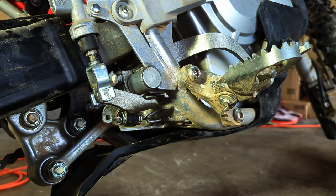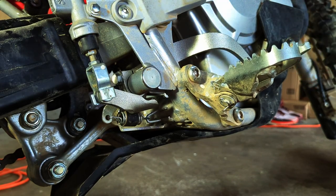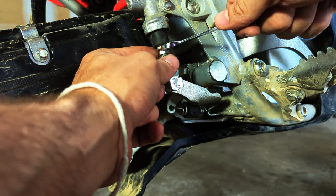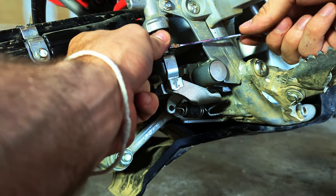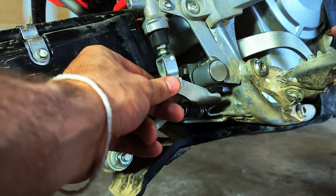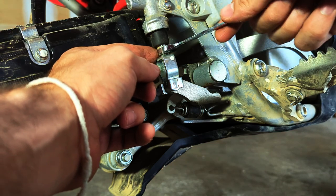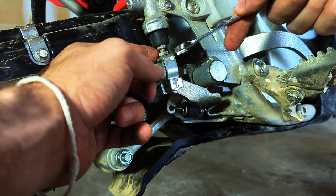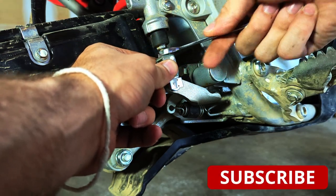Make sure you pump the brakes a few times just for good measure. If you want to adjust your pedal either up or down in reference to your foot pegs, just loosen the little hex nut on the bottom and tighten the bolt — it'll raise or lower the brake pedal. Then tighten the bottom locking hex nut and you're all good.